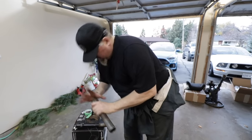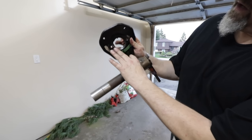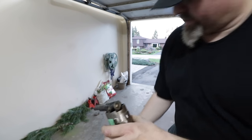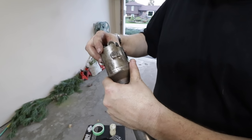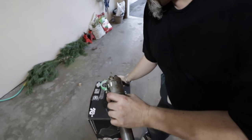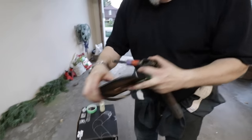The second half is this has to be welded attached to the firewall. So we have this interior bracket which bolts to the firewall, and this is where the original steering shaft bolted to. So it's the wrong size. So what we're gonna do is take this original, this is from the later generation, the AW11 MR2. We're gonna basically have this cut. Trim that all so we get a nice flat surface. Nice flush surface, and it'll then be welded onto this. What's nice about this is this will then put our U-joint assembly just the side of the firewall.